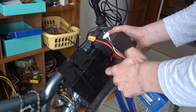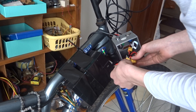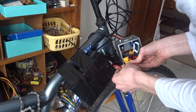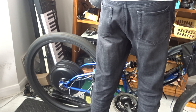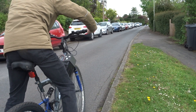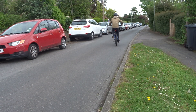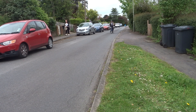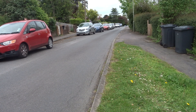The battery I'm using at the moment is a 5S 3Ah battery that can put out about 60A. I used to have 4 of them but annoyingly they all died, so I can't test the full power until I get some new batteries. Even at the moment it still sounds awesome, and on that note let's have a test ride. This wasn't at full power so that's why it doesn't have great acceleration, but it proves that the setup works and I'm certainly pleased that it all worked out. If you want links to the motor at the best price, there are links in the description. Here's a bit more testing and first person filming.